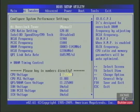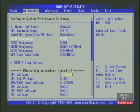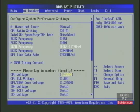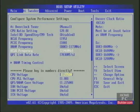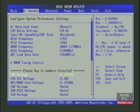Let's try to get the CPU to 3.9 GHz. A base clock of 195 times a multiplier of 20 gives us 3900, or 3.9 GHz. The RAM, UnCore, and QPI changed automatically. The RAM changed to 1173 MHz, which is fine. The UnCore is 2346 MHz, which is twice the speed of the RAM, and the QPI is at its lowest possible setting. We want to see if these new frequency settings will work with the current voltage settings, so I won't make any changes to the voltages. I'll press F10 and enter to save and exit.